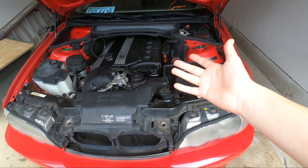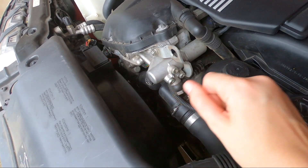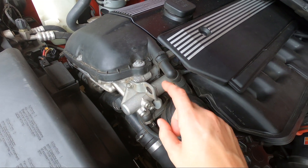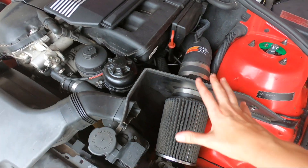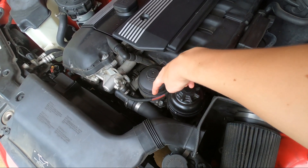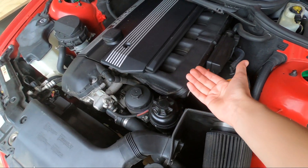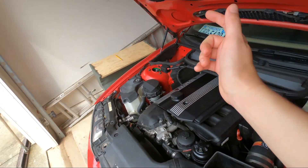Alright, so for the line, here's the top part — it's hot, I just moved the car in here and I'm surprised how hot it stays. Underneath this cover is the vanos system. The line starts here and goes down to the bottom of the block. To get to that bottom piece, I'll have to remove this part of the air box and the filter, then undo these two screws on the power steering pump reservoir, move it out of the way, and since I've got little tiny baby hands I'll easily be able to reach underneath and access the other bolt to swap out the line.